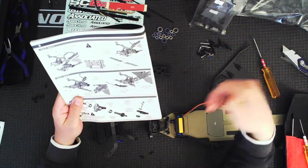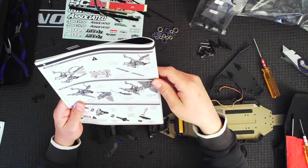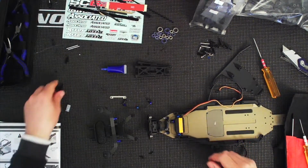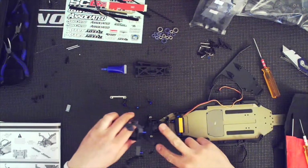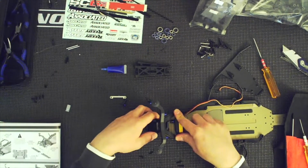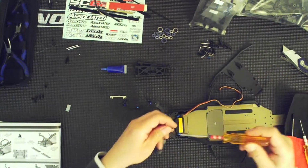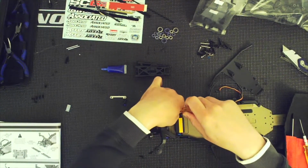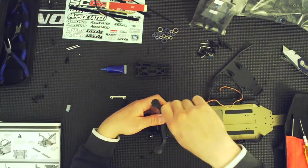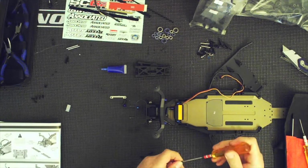But like I said, if this truck is as good or better than the 6.1, it will be a very good truck. The 6.1 was a very good truck. But here we go. So we're going to need 14mm. 14mm are here. Now these I'd already measured. 14mm are going to go back here. 10mm are going to go in the front. So this will simply key in here, which is very nice. This just fits right in. There's no possible way of mistaking how far forward or how far back. It just fits in. The bottom is conical, so it just seats properly.